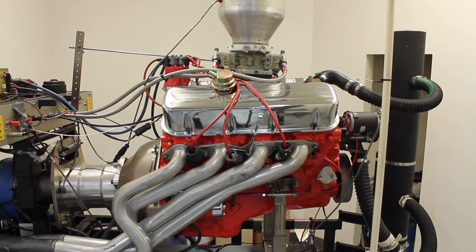So I'm going to go through what we did to this engine. Feel free to ask questions in the comments and I'll happily answer them. We had a virgin first design L88 short block with a set of 840 head closed chamber heads. We indexed the crank and set the stroke to 3.765 — the stroke was all over the place from the factory, so we cleaned that up. It's all indexed now at 1010. We used a SCAT 6385 rod with a Race Tech piston, and we set the compression at 10.2 to 1.